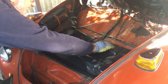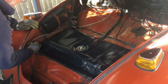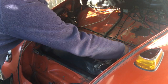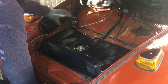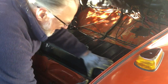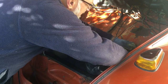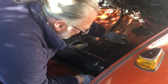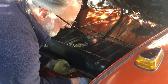We've got the clamp off and the hose is free underneath. The hardest part of pulling out the tank is that there are some wires for the headlights on the passenger side and driver's side that go through little indentations on either side of the tank, so you have to watch those as you get this out. Also, if you've got 10 gallons of fuel in your tank you're going to have a bad day — either get the fuel out or wait until you've run down.